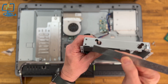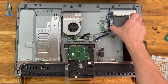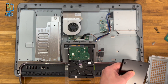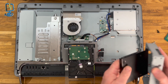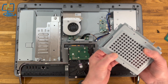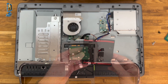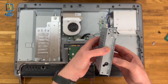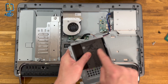You can use double-sided tape — I've seen machines where SSDs have been stuck in with double-sided tape, and I have no major issue with that. The only issue is that if the machine gets warm the tape tends to give up. I prefer to use mounting brackets. The brackets I had didn't quite line up, so I marked it up and drilled a couple of holes, allowing me to screw the SSD onto the mounting bracket. I put two strips of double-sided tape on the bracket and offered it up to the original hard drive holder.